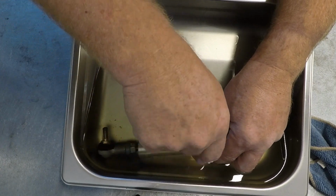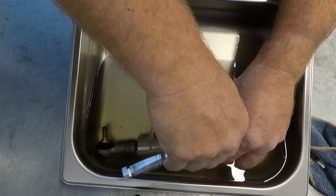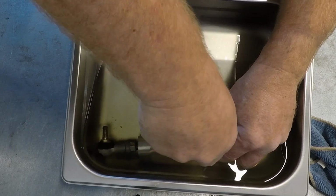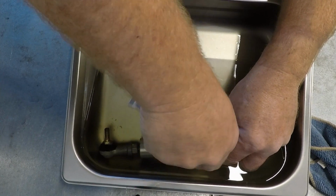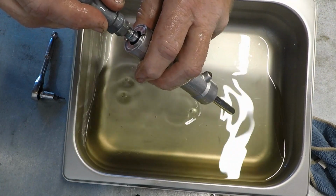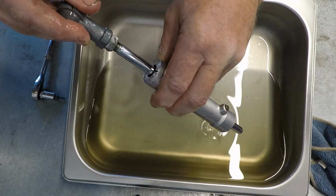You might have seen when it was being moved around that there is like a cross on either end of the main barrel there. You can unscrew these to actually get inside of them and disassemble them. They're full of O-rings. They're non-standard O-rings and really hard to get hold of. Suzuki don't sell them as a part. You have to go hunting through bearing supplies and things like that.